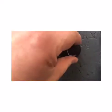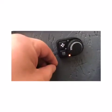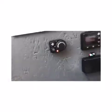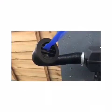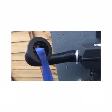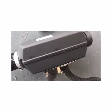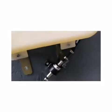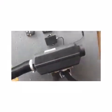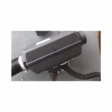This is the temperature gauge — turn that up. Press that button. What's going to happen now is that the fan will kick in for a few seconds and then it'll ramp down. Then what's happening is that the glow plug inside here is literally heating up as we speak. The fuel pump's down here — that's going to travel up to the heater and in a few seconds it'll get going.